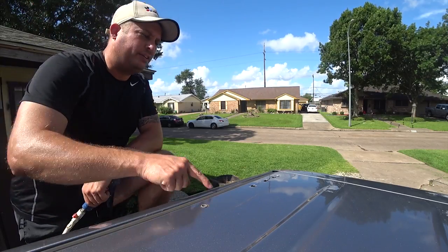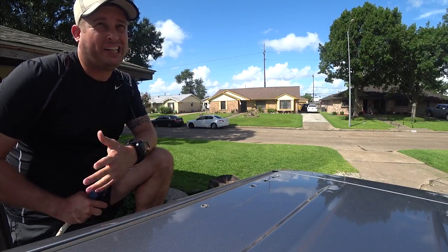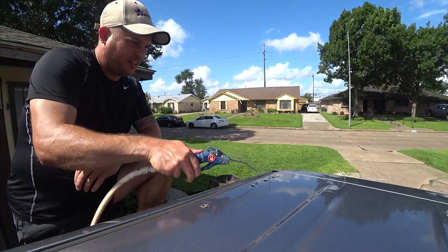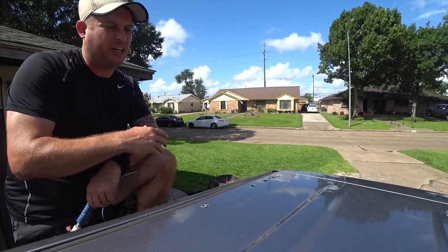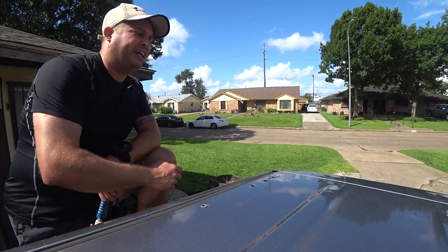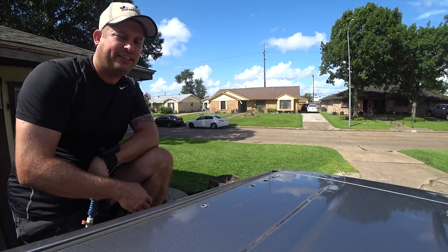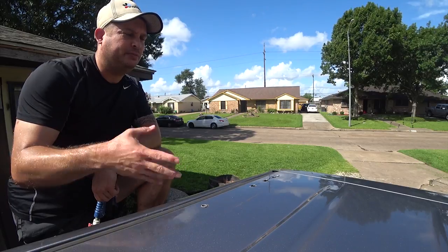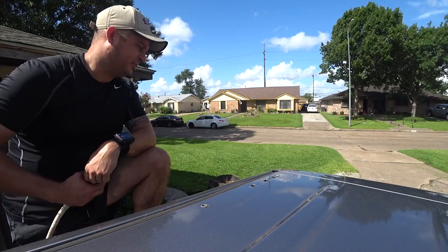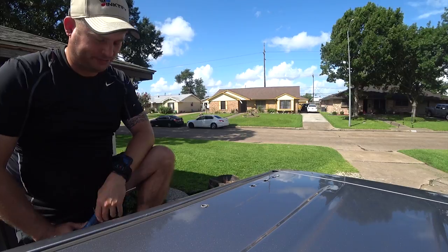After you drill, you're going to have all little bits of metal shavings, and there's a couple different ways to get rid of them. What I like to do is use an air hose and just blow them off. I've already blown them off. I forgot to video it. So anyway, what you don't want to do is brush it with your hand, because these things are like little splinters and they will dig into your skin and you will hate life. You are far, far better off to, if you have to, use a towel. But again, you're going to get little metal shards everywhere. So the best thing to do is blow them off with an air hose.